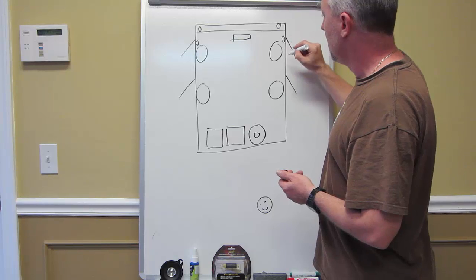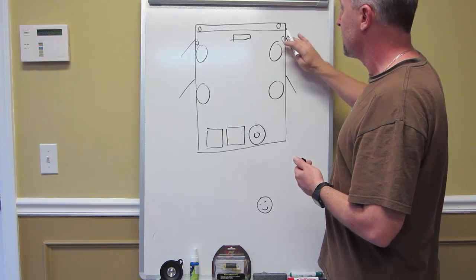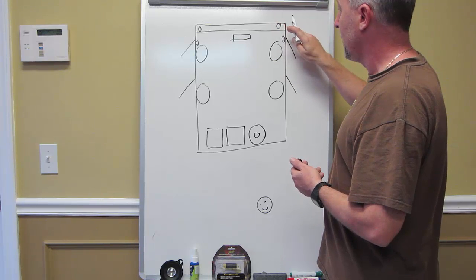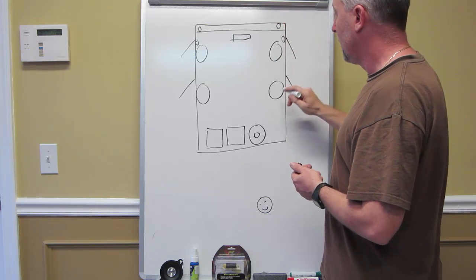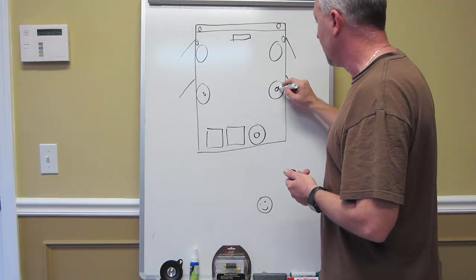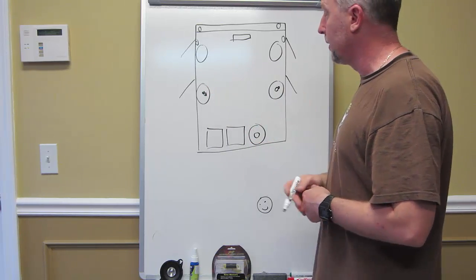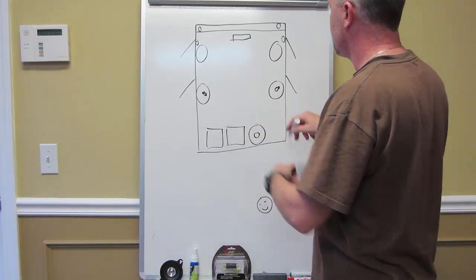So he has a 1-inch silk dome tweeter, he has a 6.5-inch mid-bass driver, so he's got a pretty good front stage, even with the absence of the 3.5s, which are the ones that are giving him the trouble. The rear fill, he's got the three-ways again, and that's just fine. I have no problem with that. He likes bright sound, and I'm a fan of bright sound as well, especially with my hearing after all these years. His rear fill is taken care of.